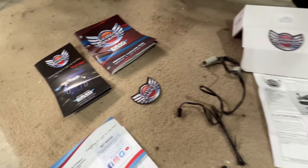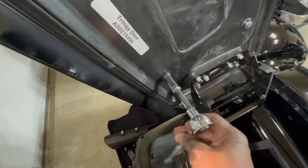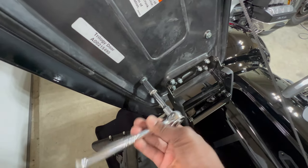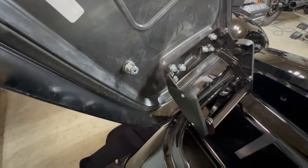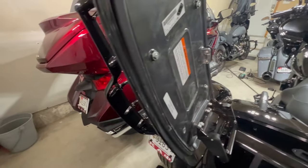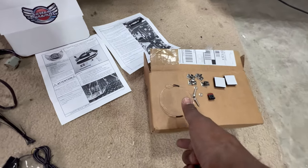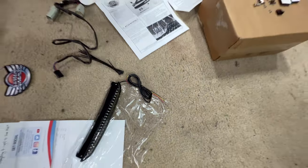I'm using a half-inch socket to remove this one bolt. It's not exactly a hole but it's hollow, and that's the one that allows you to run your wiring through. Got this off — I have my plastic washer and my metal washer on there, and that's the hole I drilled. I'm going to go ahead and get this wider piece here and try to run it through, and if it goes through, all I have to do is tape the ends of that to pull it.